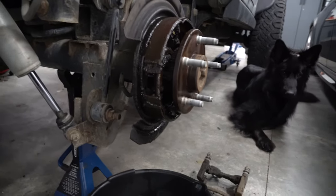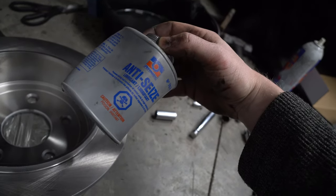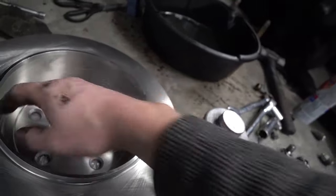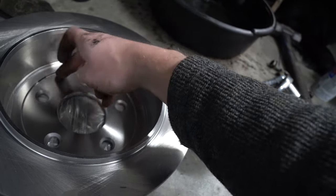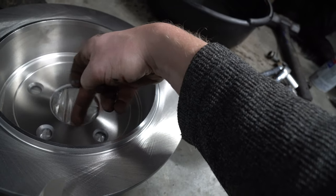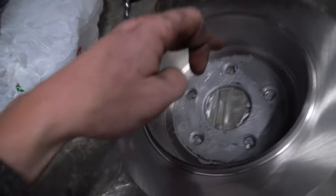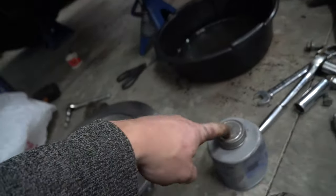Make sure you crack a door so that way the brake clean vents to atmosphere rather than your lungs. Before you put your new rotor on, consider putting a little bit of anti-seize on the back of your rotor — only in the section where the hub actually makes contact. You don't need to go all the way in; just right here along the inner line, around the inside of the bolt holes, and in this axle area where it majorly makes the most contact. Make sure you put the rotor on its plastic bag when you do that, use the brush, and be careful not to get any on the rotor face — anything that drips on is turning silver for the rest of its life.